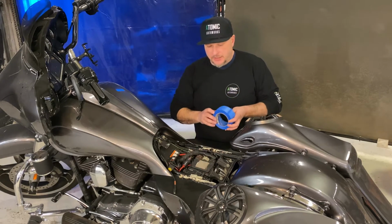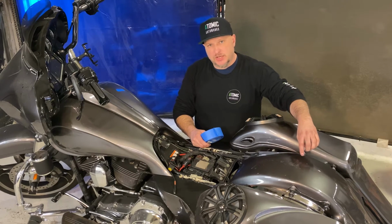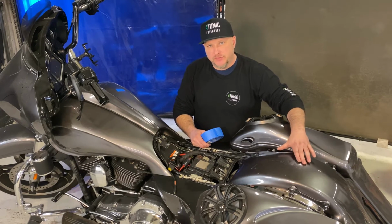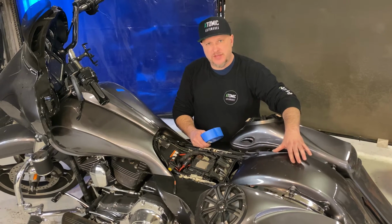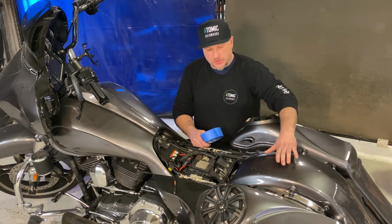When we make this seat here, even though it's a Velcro seat, the reason people do the Velcro seats on the bike is they want that seat pan to hug it, especially on a custom bike. You want the seat to sit really close to the bike, no gaps, and have it really even. You also don't want to have a tab and drill holes in your fender. So on this one, the pan we're going to make, we are going to have a location for a tab just in case he ever wants to put an actual tab in there to make the seat stop sliding around. I'll show you how we do that.